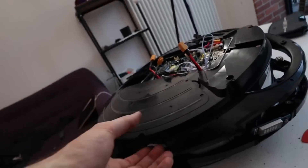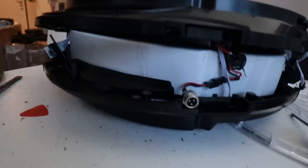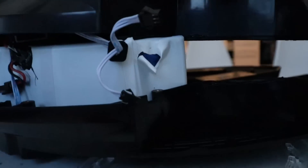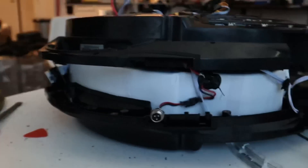It's also interesting to see that most of the V10F interior is just plastic and empty space. The battery is on top and the motherboard is on the side, but otherwise the wheel could probably be a lot smaller. Some people say the top-heavy battery placement makes it unstable, but having ridden it quite a bit, I find it surprisingly stable. The connectors where they pass through the middle of the shell also have rubber sealant, and all in all InMotion did a pretty good job on the water sealing. You can also see more silicone where the two halves meet, and the plastic casing of the battery, along with the heatsink that draws heat out of the wheel.